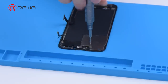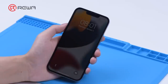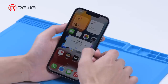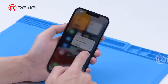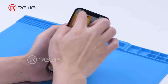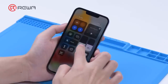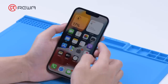Next, we install the Sensing Flex cable. Both the display and touch remain fully functional. The screen refurbishing method of iPhone 13 lineup is easier than its predecessors — there is no need for bezel frame separation. Additionally, the touch panel is under the polarizer, making the touch less likely to get damaged.